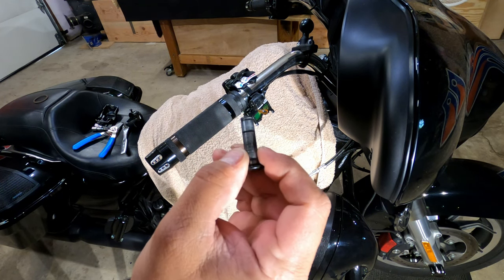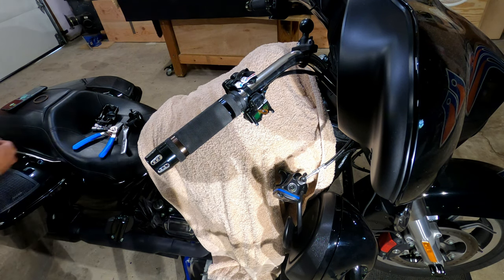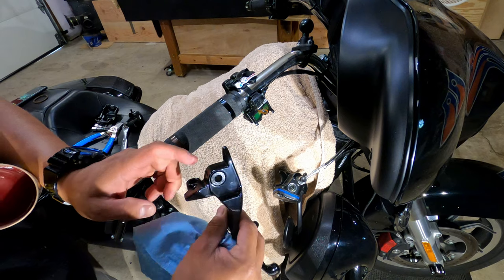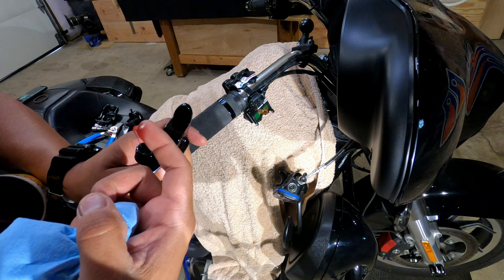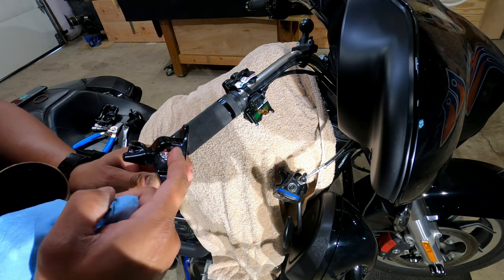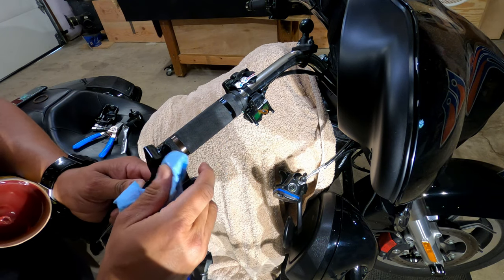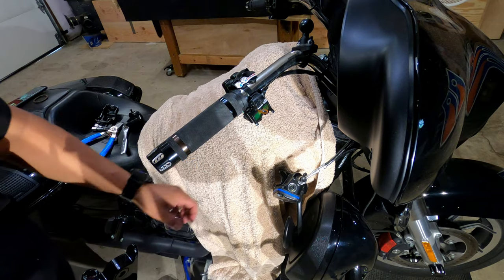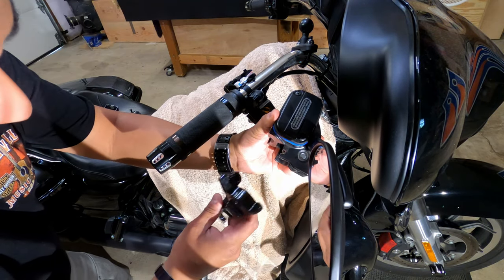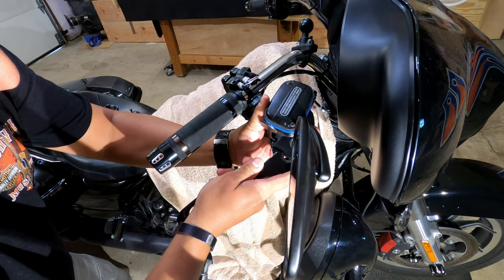If you can see the little slit at the top, that's where the retaining clip slides into when you put it back. We've got the brake lever here. What you want to do is add a little bit of grease to the two fittings — you don't have to overdo it. Just get a little bit of this red grease, put some in the little cup, and a little bit inside the top of the fitting. Just wipe off the excess and we're ready to get this thing back in. Make sure the little cup fits onto this little push pin because that's what actually actuates your brake master cylinder.